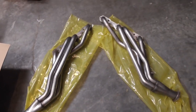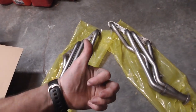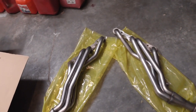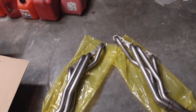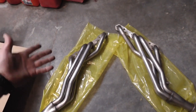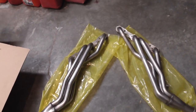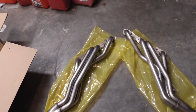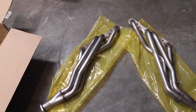If these don't fit I'll just go short tubes, but I'd rather have long tubes because you get more bang for your buck and more torque. Short tubes versus stock manifolds are almost identical, so there's really no point spending money on short tubes when the gain is minimal compared to long tubes. To get any real performance you're also going to need a tune — tuned to the exhaust, to the headers, and any other modifications.